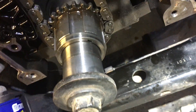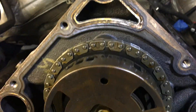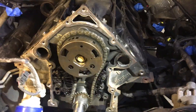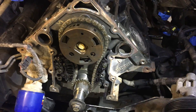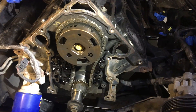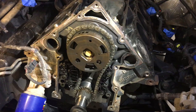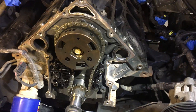It took me a long time to figure out — probably about a week and a half of research — because I didn't want to mess up my truck. What I've got going on is a bad lifter, an exhaust lifter that I'm taking out and replacing. My truck right now is in TDC. When you're cranking through it takes a while, but take your time, continue to crank, and it's going to line up. As long as your truck is in time to start, everything's going to line up and it's going to be done right.